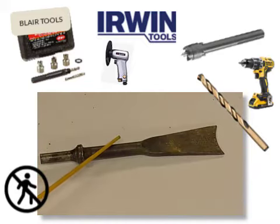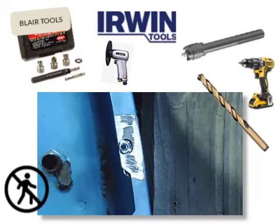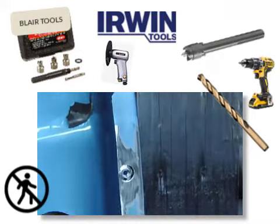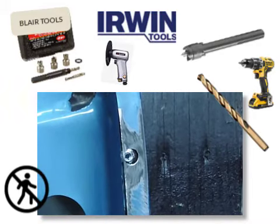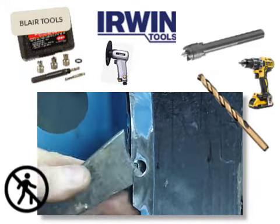You only have to buy this tool once. It will last a lifetime. Load the bit into the air hammer, get in between the two layers of sheet metal and separate them. Do the same thing on the next spot weld. Then go to the last one, which is already broken, but we get in there to make sure. And we are done.